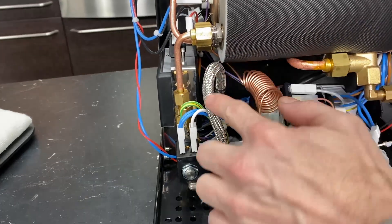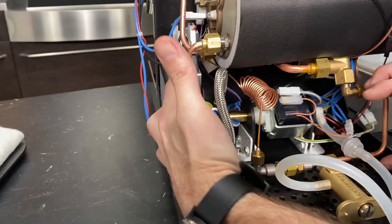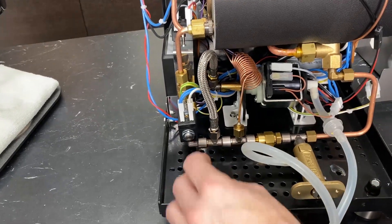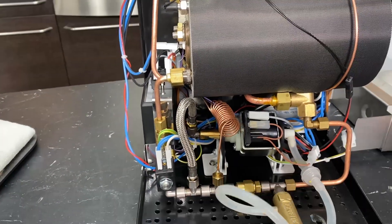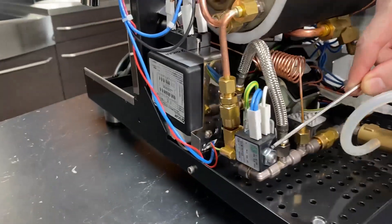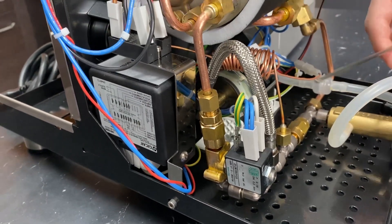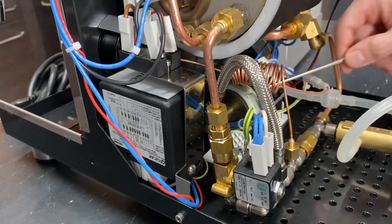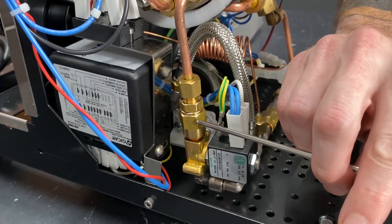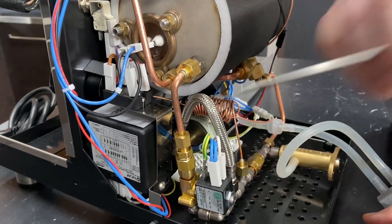Off the pump, come over to this braided hose line, and now we're into the big valve tree. This is where everything kind of branches off and goes where it needs to go. So we're going to start off going towards the service boiler side. This solenoid is the first step — this solenoid will open up when the boiler calls for water. It'll open up the solenoid and kick on the pump. Right past the solenoid valve is this non-return valve — like a one-way valve — so the water can flow up into the boiler, but it can't make it back through it.